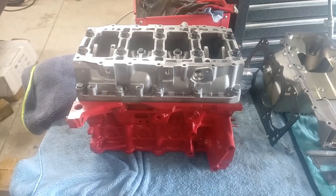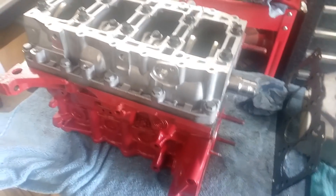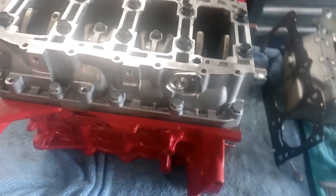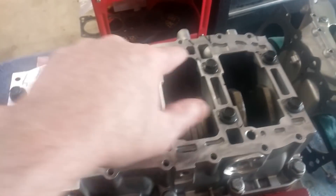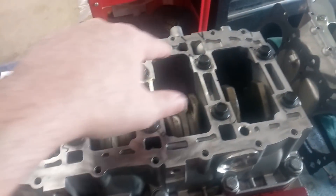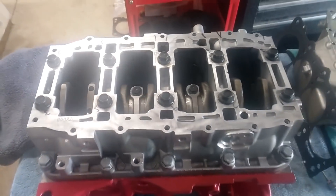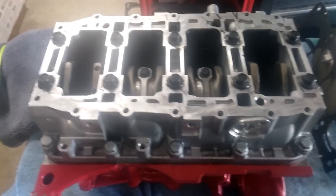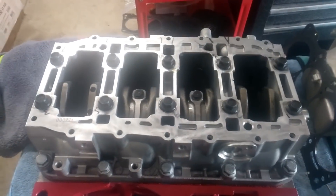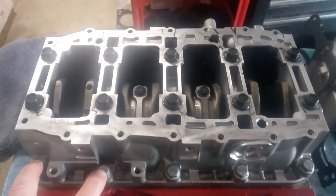They would very rarely come with all of the other external things like manifolding, water pump, etc. So short block assembly is done and it went together very, very well. I'm happy with it. There are a few things from the previous video I want to clarify. First, we have 20 main bearing bolts numbered 1 through 20. Numbers 1 through 10 are the ones you need to inspect and make sure they're not stretched, and the ones you may want to replace if you're doing a performance build. A standard build, it doesn't really matter.